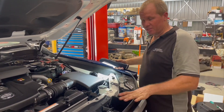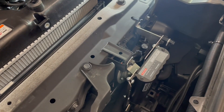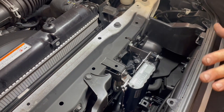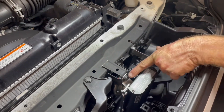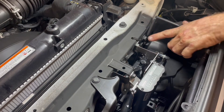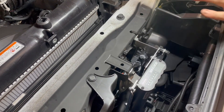We start by mounting up the DC-DC. It mounts on the Redarc 300-specific bracket, so it all mounts in place here. It mounts to where the horn is — the horn goes back in at the front to install that. Then it mounts off a lower point and a couple of other bolts that are already in the body.